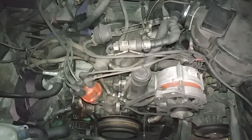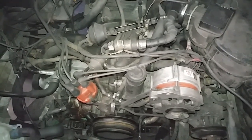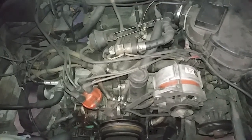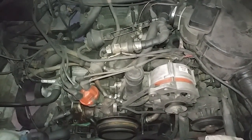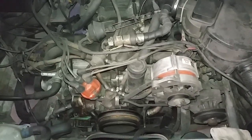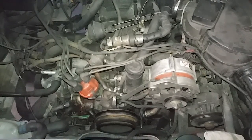There is an adjustment. The book says 2 turns for the adjustment. I have seen valves get too tight at 2 turns because of the valve seat wearing, the stem of the valve pushing farther or more against the rocker arm, and that keeps the valve open.